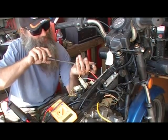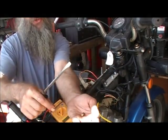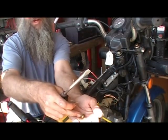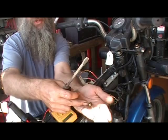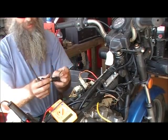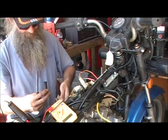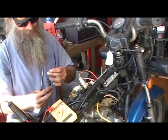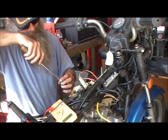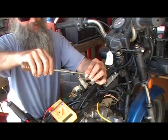What happens inside these boots: there's a spring to keep contact, there's a resistor, and then there's a screw-in thingy that holds all that mess. I don't care what the right name for that screw-in thingy is — I'm a redneck, that's a screw-in thingy. The spring goes in, then the resistor goes in, then the screw-in thingy goes in — screw it in with a flat screwdriver.